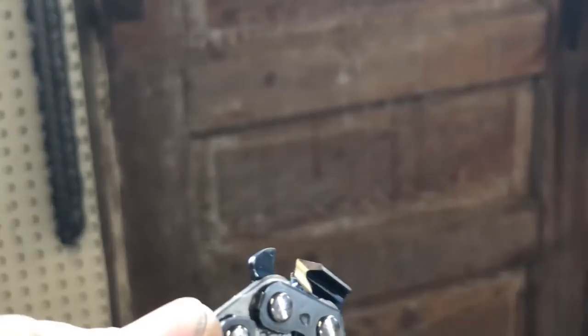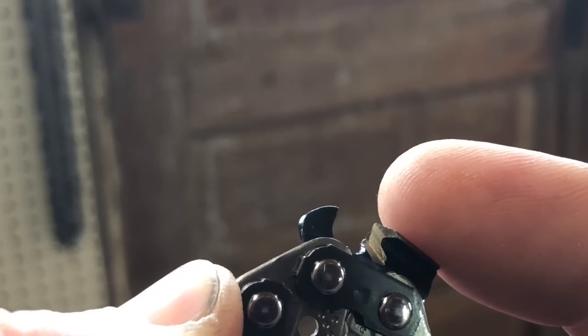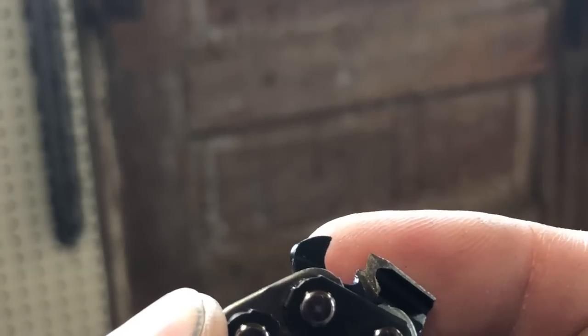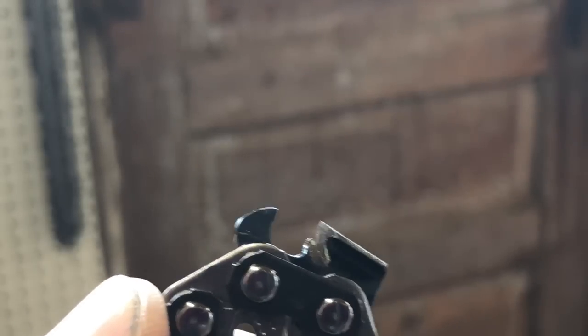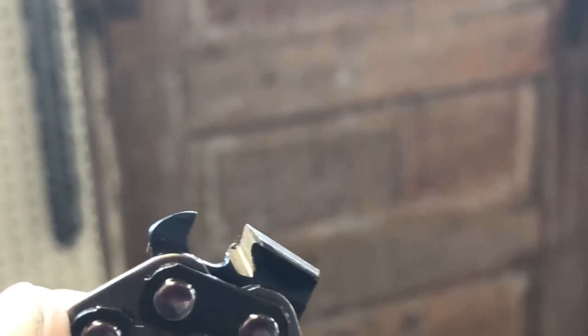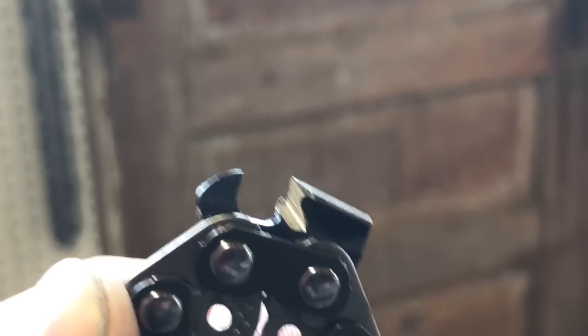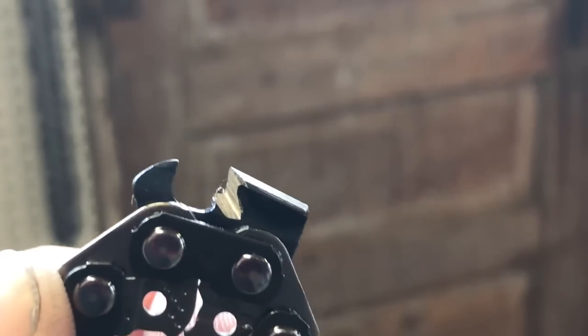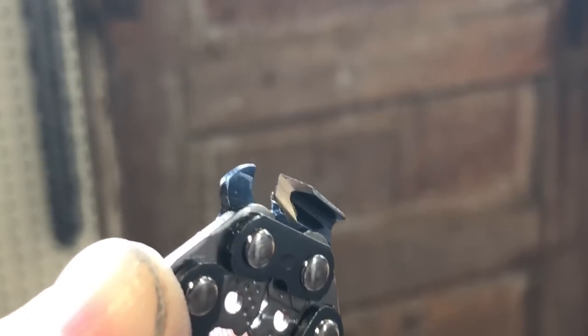What this creates is that the upper plate up here still is your chisel. It's got a good edge on it, nice and sharp. You've got your sharp point, your sharp side plate, and there's no roundedness inside there. So you have two distinct chisels attacking your wood. Nothing is rounded off. It's a very sharp chain, sharper than a full chisel round ground. Some people say more aggressive, however you want to use the terminology, but that's the gist of it.